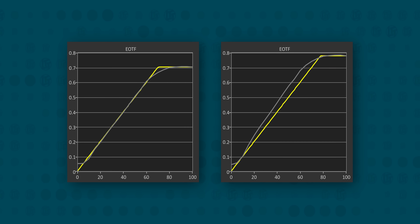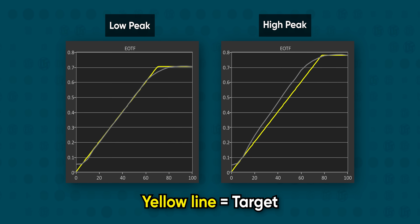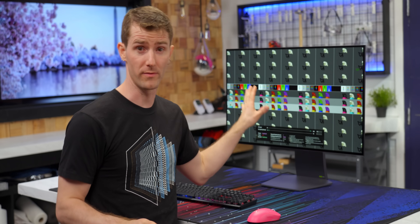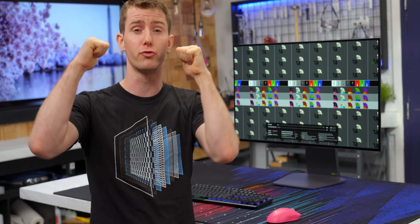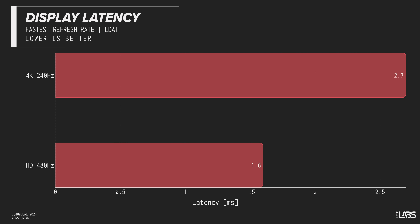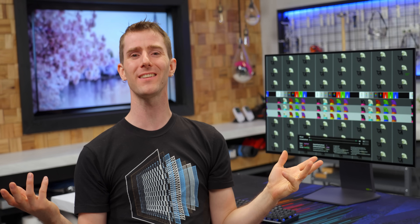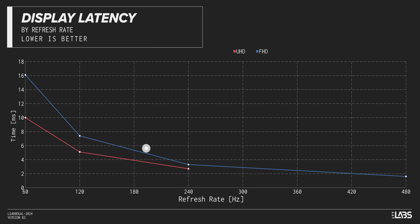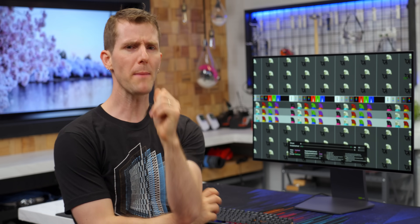In HDR we measured both low and high peak brightness modes. Low is best viewed in a dim room, while high managed over 1200 nits in a one-percent window for dazzling highlights. Now let's talk about responsiveness — this is a gaming monitor first and foremost and both modes are great, but they have some small differences. Because it refreshes at half the rate, the 4K mode has inherently worse input latency — we're talking about a difference of about one millisecond. The reason faster refresh matters for OLED is because of how our eyes perceive motion: by switching more frequently we will see fast-moving objects with better clarity. The 1080p mode has a curious trait though — if you run it at a lower refresh rate the latency goes up faster than you'd expect, perhaps due to scaling.